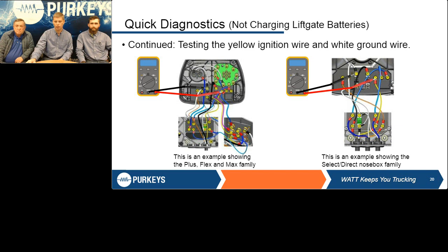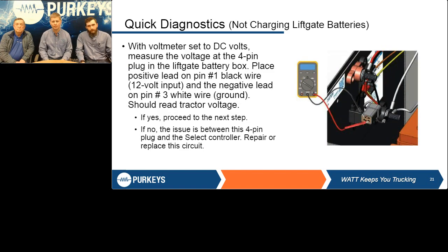To summarize the four-conductor main harness commonality across all systems going from the nose box back to the plate assembly: white is ground going back to the plate, black is power for your charging line, orange is a power line going from the liftgate batteries up to the nose box, and yellow is ignition — that's what turns the converter off and on. One of the things we always try to do is fix liftgate charging issues without causing a truck no-start, so there's a lot of logic in that nose box to charge batteries without creating another problem. No matter which system you're working on, those four wires are all the same.